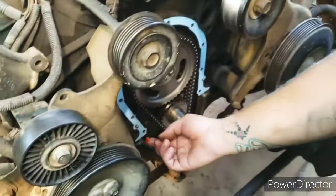I almost forgot. This is the engine plug on the driver's side. I did the freeze plug on the driver's side and forgot to put the plug in on the passenger side. Okay, now, the fat end, you can see it's got a little flare that goes on the water pump. The other end is on the radiator. And I haven't hooked up the transmission lines yet so I can keep them out of the way. And we've also got this shielding, whatever you want to call it, on there to keep it from chafing up against the frame. So we just need to slide a couple clamps over it.